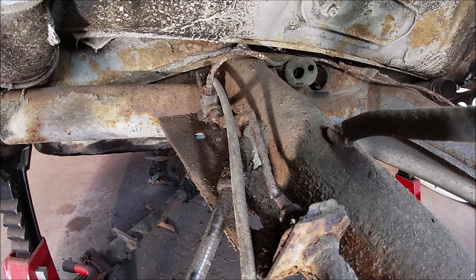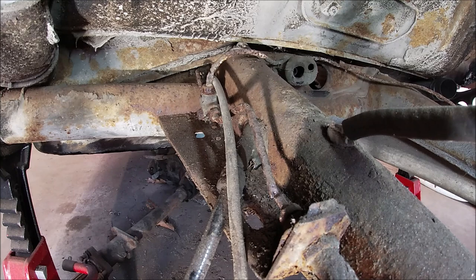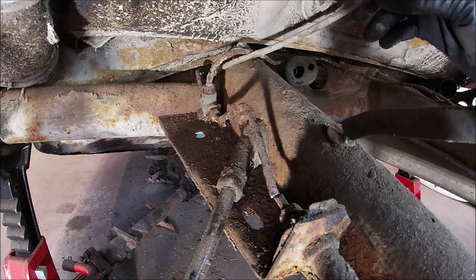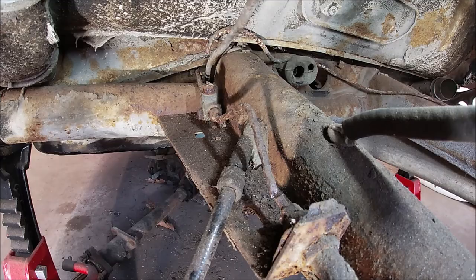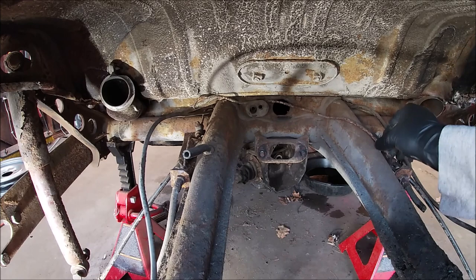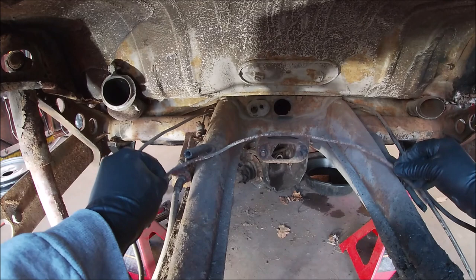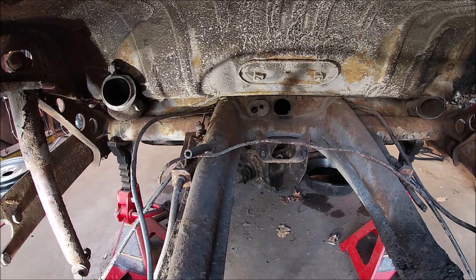I have to cut all the brake lines off. I cut this brake line — it's okay, I could replace that anyhow. When you go to take this off, you want to mark this. If you have to do your brake lines, mark P and D — I'll put tape on each side, so that way it's passenger side and driver's side. When you're bending your lines, at least you have a reference to get you started somewhat.